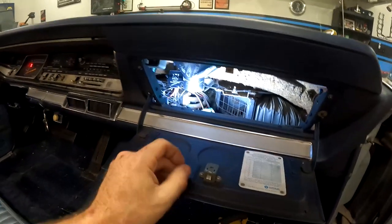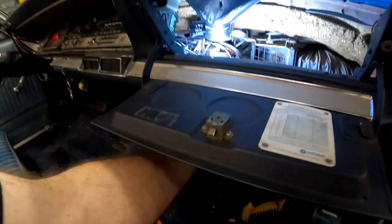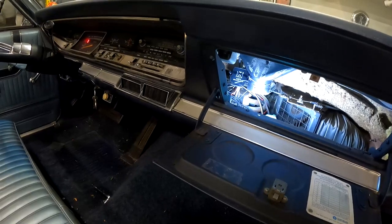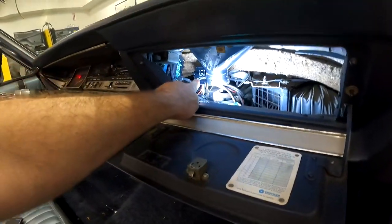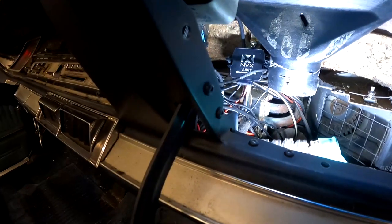So I think our switch is gonna have to be rethought. Not that I need more work to do, but somehow when I turn off my switch, all I get is noise. And I think I know what's happening. It's actually not disconnecting the Bluetooth. It's still powering our little Bluetooth unit there, and it's probably using such little power.